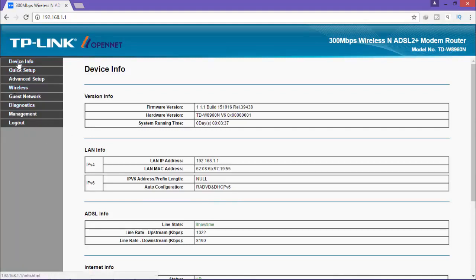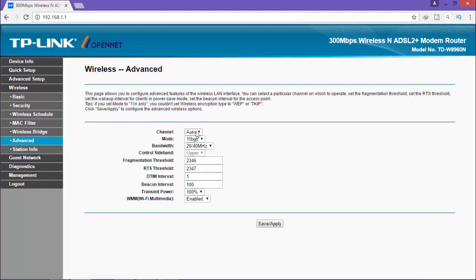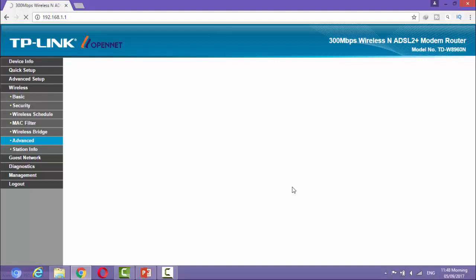After that you can see many options, but I choose only the wireless option here to change the wireless channel. Go to advanced and you can see the channel setting. You change it from auto to any fixed channel that you want. I recommend the best channel is channel 11. Then you click save. You see this page means you saved it already.